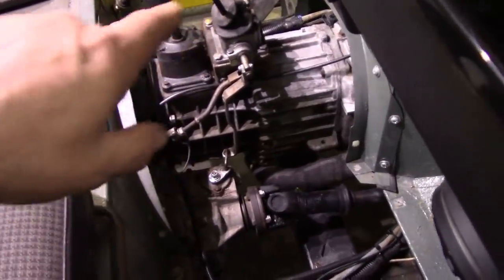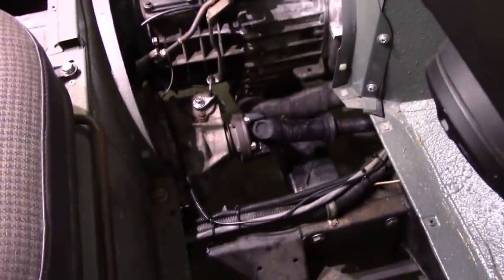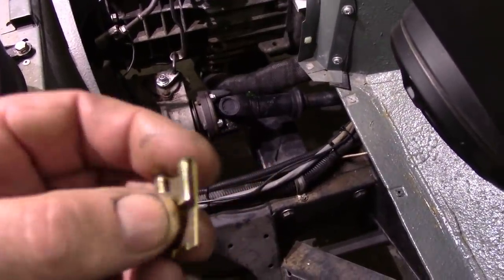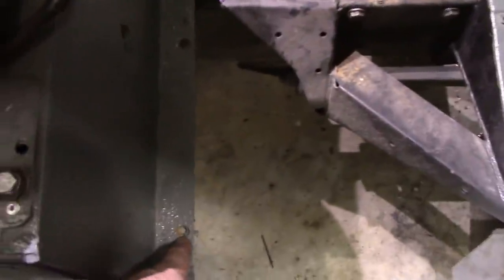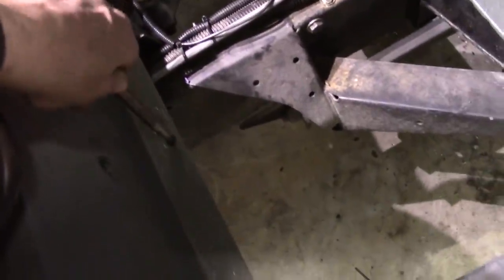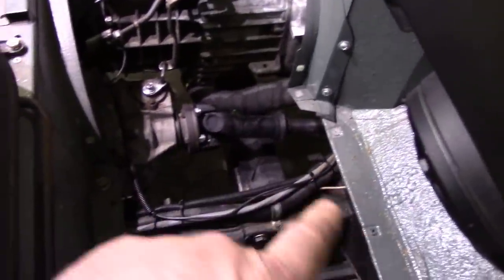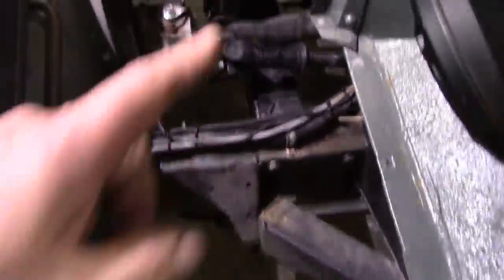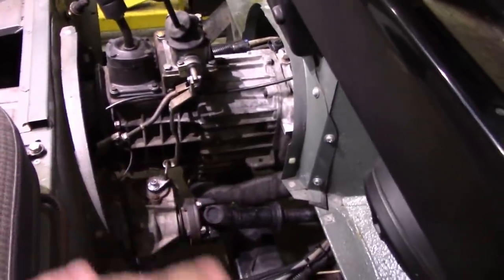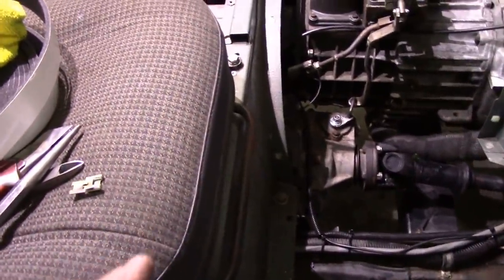I'm happy with this but I haven't put grease on all the pivots because I know I'm going to take the transfer case off again to replace the shaft. What I've done is I've already replaced these Acme nuts — speed nuts, I don't know what we call them — they're already in here. Get a little taper punch and line up the holes, make sure there's no dust, dirt, or debris. If you're unsure about any grease on there, just put some brake cleaner on and give it a quick clean.